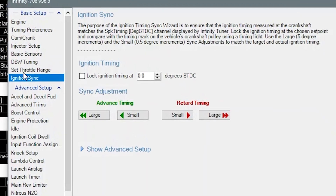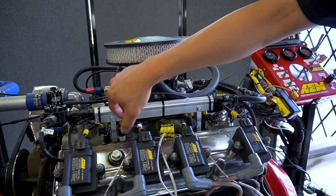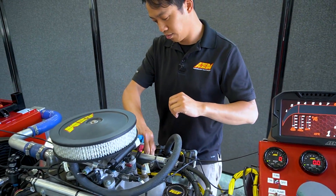It doesn't really matter what that value is — ideally it's something that's marked on your crank and easily visible. Before we start the ignition sync process, we want to make sure that we get sync state, meaning the ECU is happy with the number of crank teeth it's seeing per cam tooth. Prior to getting sync state, your coils and injectors will not fire. To test for this, we're going to disable the injectors to ensure the engine will not fire, then crank the engine over to make sure sync state goes from zero to one.